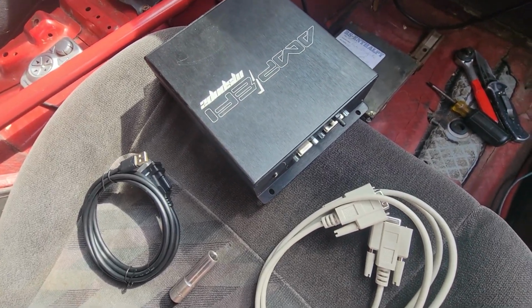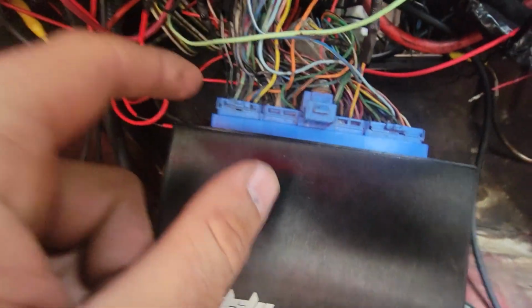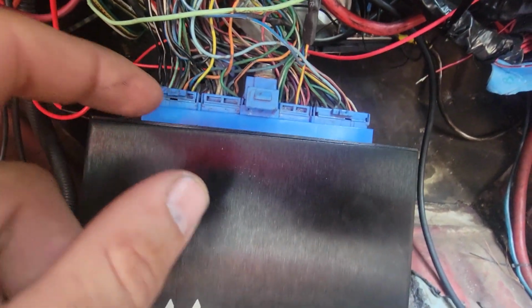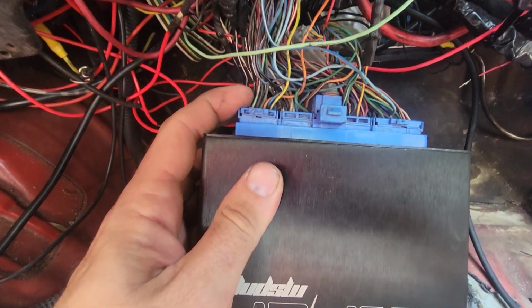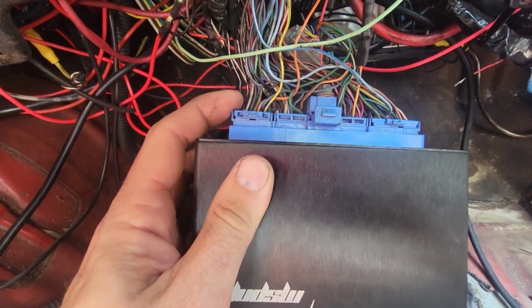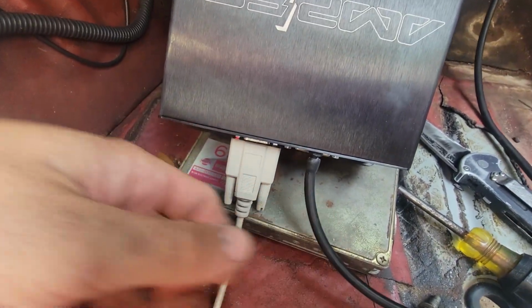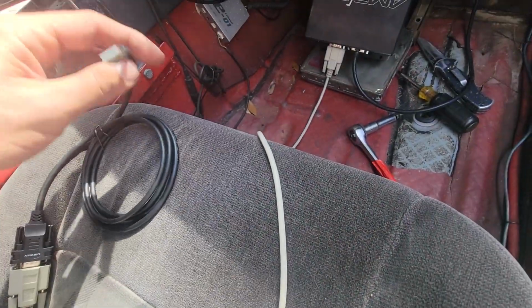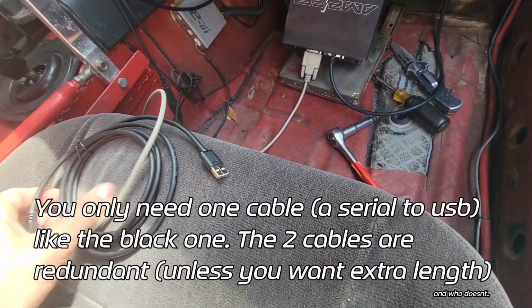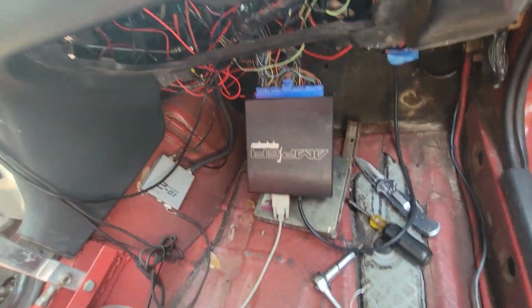I'll show you all that, but I need to do that before I even think about cranking or any of the other stuff. So this doesn't appear to bottom out like the factory one. I felt like I was cranking on that 10 millimeter way too hard, so I stopped and backed it out, but it doesn't seem to want to seat anymore. I don't know, I'm just leaving it. Okay, laptop connection, MAP vacuum line. I've got this hooked up. So now I'm going to get the laptop and see what happens. Oh, and plug the battery back in, because I unplugged it because, you know, electronics.